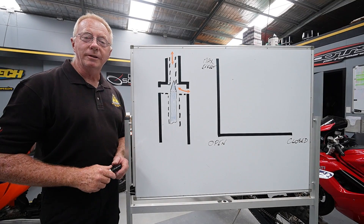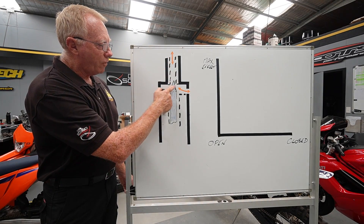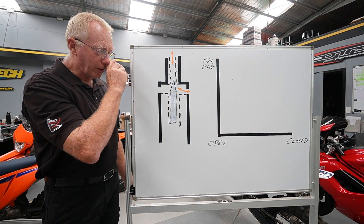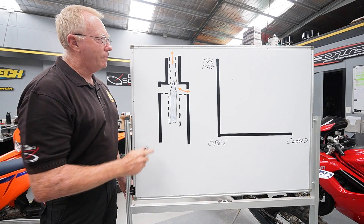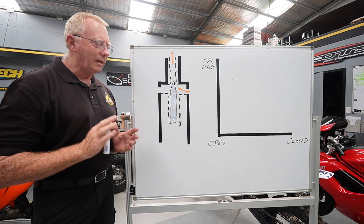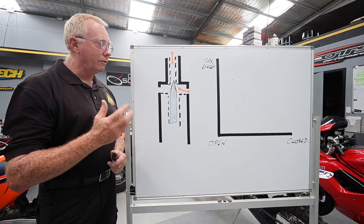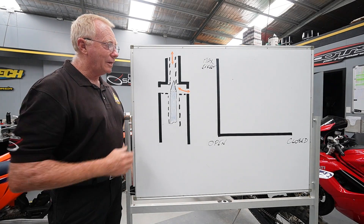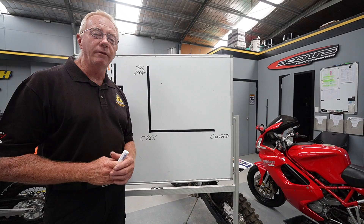As we wind our rebound adjuster in, it's going to have an effect on both compression and rebound, so whilst we're slowing the rebound down, we're actually making the compression firmer as well — hence the reason you'll find on most shock absorbers they're marked hard and soft as opposed to slow and fast for the rebound. To make this easier to understand, I've put a drawing up here. We have our shock shaft, our tapered needle coming up the center of the shaft, our flow port — our point of restriction — and the arrows indicate oil flows in both directions. On the rebound stroke oil comes in through the port past the needle and out the top; on the compression phase it comes the other way — down past the needle and out the side.